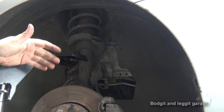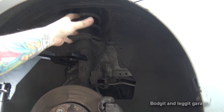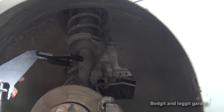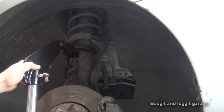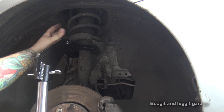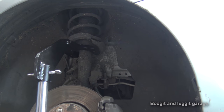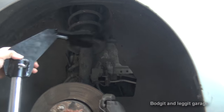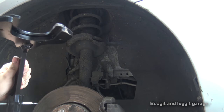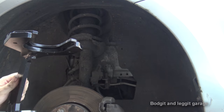Imagine we've just changed the shock, changed the spring, changed the hub — whatever we happened to change. We need to get it back in because the three bolts, two bolts, or however it's bolted — it's just awkward, you're trying to reach around. So this comes underneath and we just slot it in there. It's as simple as that — it's designed to hold the strut in place. Once you've got it in place you can move it so all the bolts line up. Then you walk away, go to the top of the vehicle, bolt it in, and that's it. Really simple and quick. When you're finished, just remove your transmission jack and slide it down. You can see the extra plate on there depending on how thick your strut is — it's designed for different ones. Just two Allen keys in there and that's it.